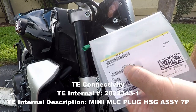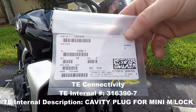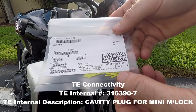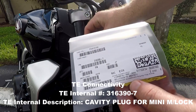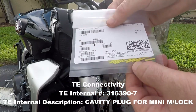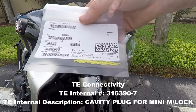The left-hand side is a little bit different — in this case it's a black connector, but it doesn't matter; they're the same type of connector. Another thing you're going to want to get is connector plugs. You're only using three wires out of the seven, so you need to make sure you plug the remaining holes so water doesn't get inside these connectors. The part number is 316-390-7 — those are yellow, the only ones available. It doesn't really matter what the color is as long as you get them plugged up.